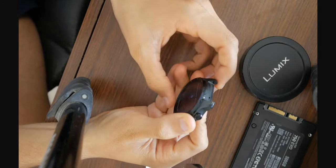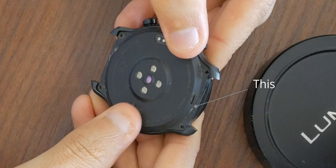I was as surprised as you when I found out it actually worked and started working normally again. I'll report back if I have any issues in the future. Here are some considerations when you do this yourself. This problem is by design in my opinion — if you look at the back panel, there is a little hole which allows airflow and has a little grill so that water doesn't come in — but it doesn't stop water. It's actually directly connected to the chip that controls the heart rate, so you really don't want water getting into those areas.